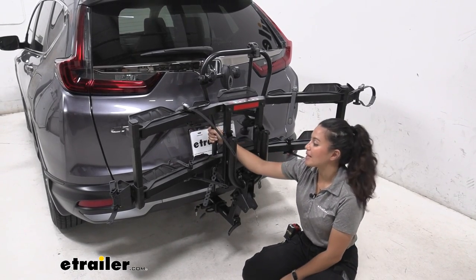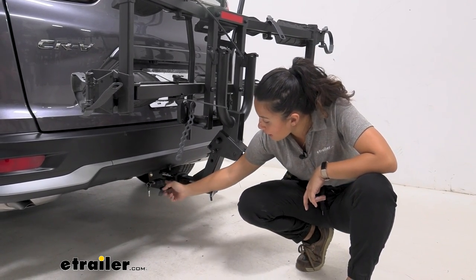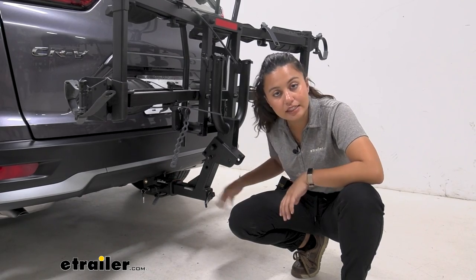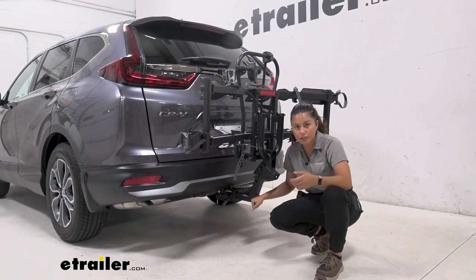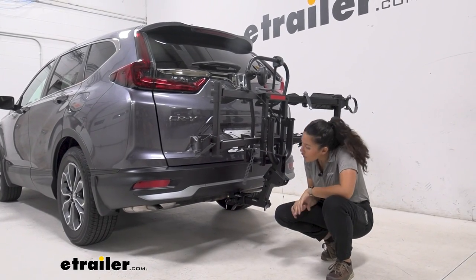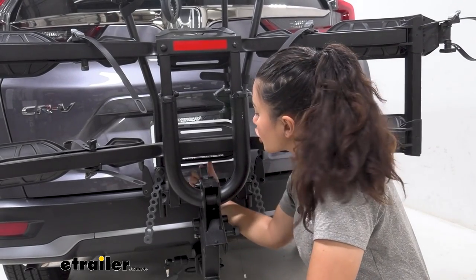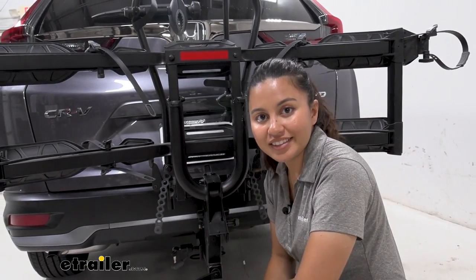This rack has a two-inch shank that fits into a two-inch hitch receiver. There's a pin and a lock — the lock is keyed the same as the clamps on your frame mount. The anti-rattle system is this lever: pop it in, line it up, then insert the hitch pin and tighten it down with the lever. With everything tightened down, when we shake the bike rack, the car moves rather than the rack — a really good fit. Just double-check the handle after a bit of driving, and if you feel up-and-down movement, check that the tilt-away lever is tight.